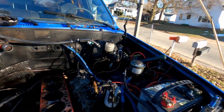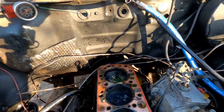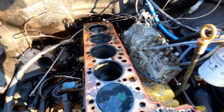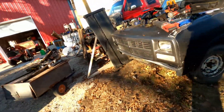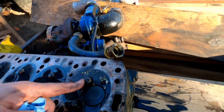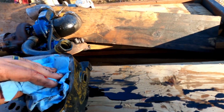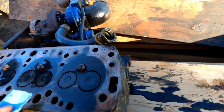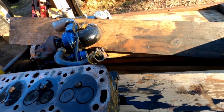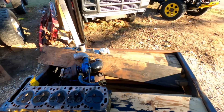All right, it's about five o'clock — the weekend's gone too fast. There's nothing obviously wrong with this head gasket. I'm going to peel it off. In this back chamber I can see that it's been burning coolant — that crusty stuff is coolant that's been burning. This is cylinder five. I don't see anything obviously wrong here — it's not like there's a visible crack.